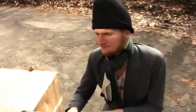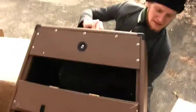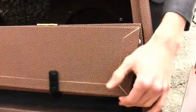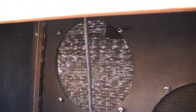This was custom made by a man — somewhere on the East Coast, probably. Cost enough to ship it, but it's pretty light. Now this is what we call a convertible design, meaning it can operate in either a sealed or an open back enclosure. That will affect the bass of your tone. With a sealed cabinet, you're going to have better bass response due to the lack of open rear and front sound wave cancellation.